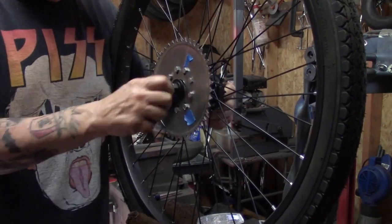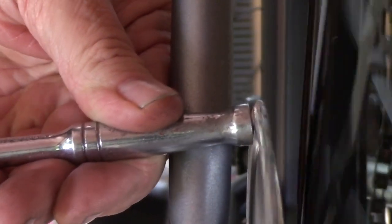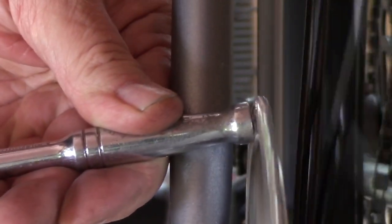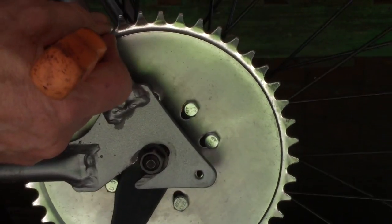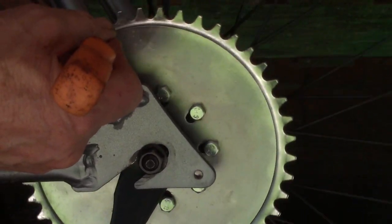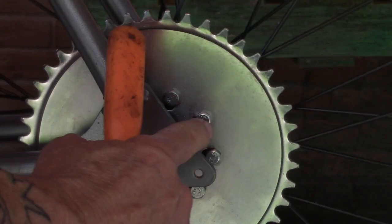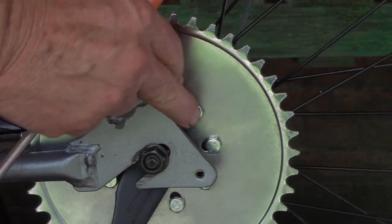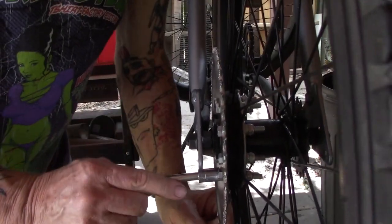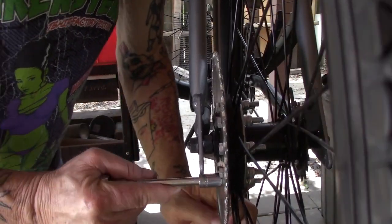Let's mount the rear wheel on the bike and put your pedal chain on. We have to true the drive sprocket - the rear sprocket - to make sure there's no side-to-side play any greater than the inside dimension of the chain. We're going to hold an indicator - I'm using the ratchet handle or screwdriver - and find the high spot: basically the part of the sprocket that pushes up against your tool the most.